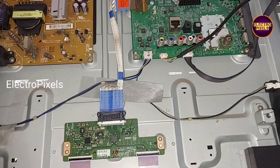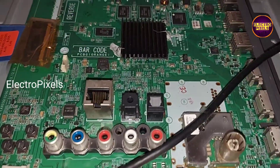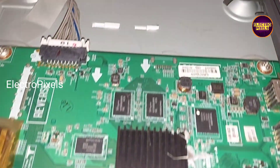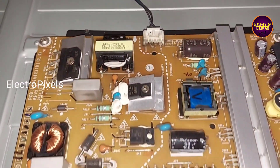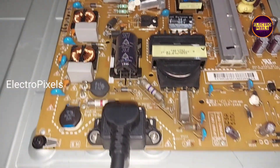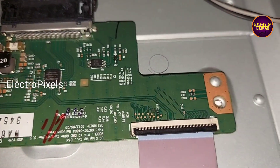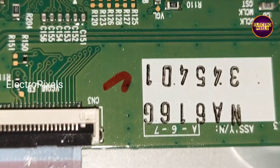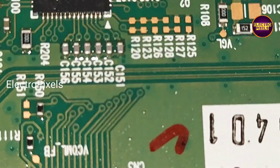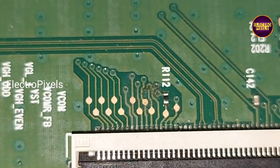After all, we can repair this fault using a temporary solution. If the shorting is in any one side of the gate signal, we can solve this panel-related issue by blocking the gate signals from that side - that is just a temporary solution. See friends, these are the gate signal tracks from the left side; we need to block the 13 pins.